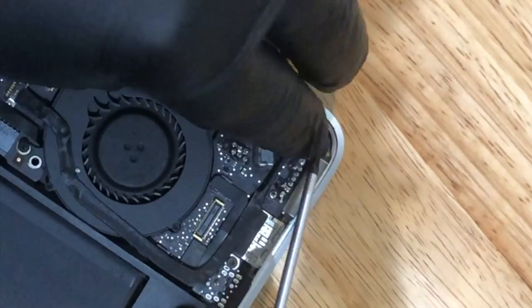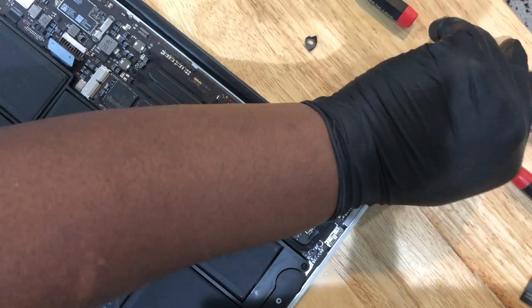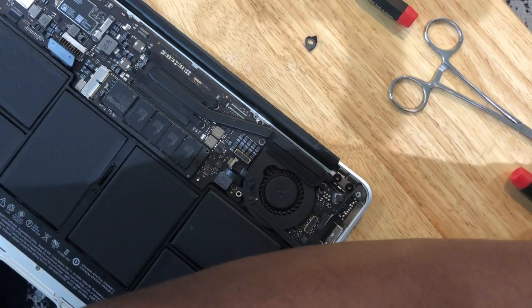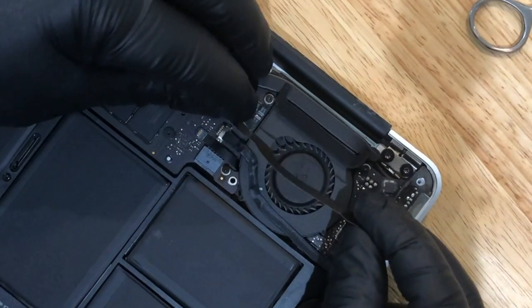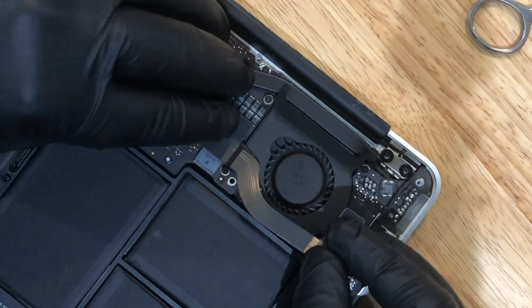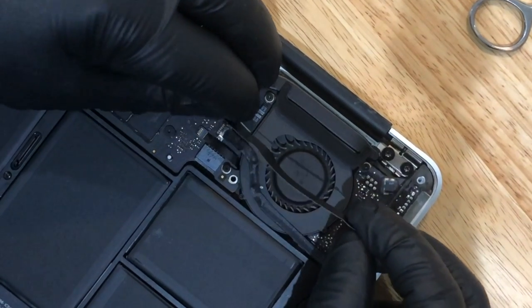Place the triangle covers back on the corners. Reconnect your bridge cable — take your time to align it with the slots it goes into. Do not force it; it should slide in easily. Apply a little bit of pressure and it should just snap in on both sides.